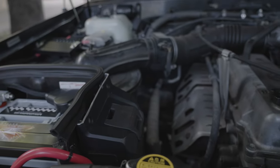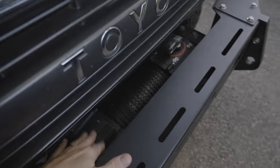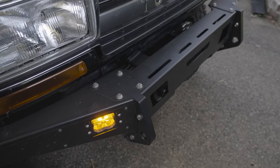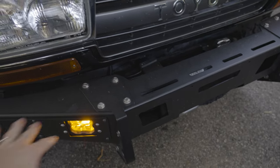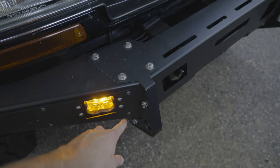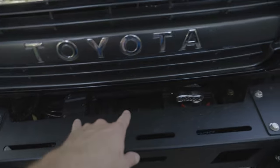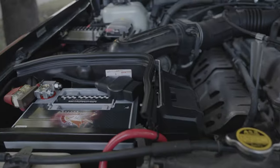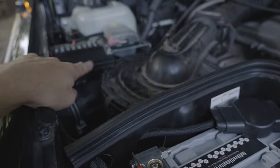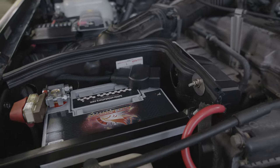I cleaned this all up with my Hercules angle grinder and got that sorted so it could be mounted up inside. With the grill the way it is, the winch control box couldn't stay on top. I was also able to mount my Harbor Freight Badlands winch controller right here, which turned out awesome — we've got the wired connection and the switch right there. This is the Descent front bumper without the triple hoops, and this flush-mounted SS3 is mounted behind the plate — I think it looks great. All the fog lights are wired up, winch is wired up, dual battery is all set up, mounted, and clamped down. We'll just have to run power into the cabin and set up the whole dual battery system, and probably even a house battery system — still deciding on that.